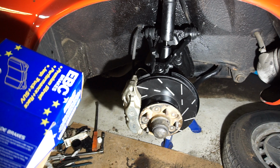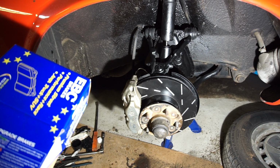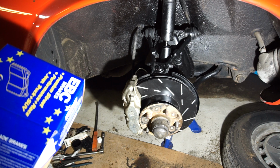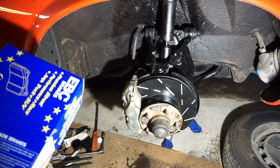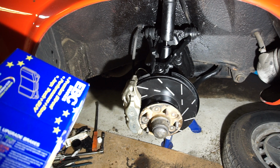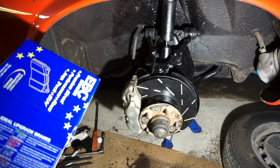Red stuff is a little bit too extreme, but yellow stuff I really like, because it's an ultra high friction formulation for brake improvement on heavy loaded vehicles or ultra fast street use and entry level track day use on passenger cars and muscle cars. So that's for bigger cars, for more use.